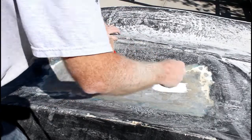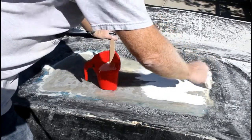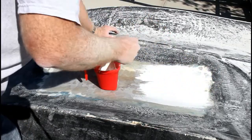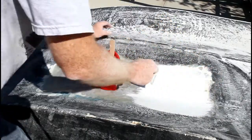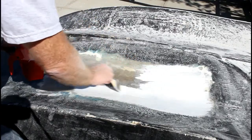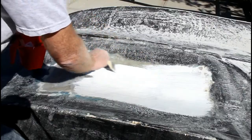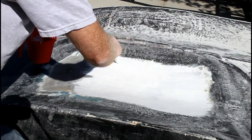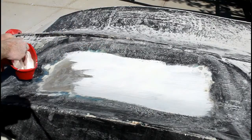This is just a paint-on gel coat — you can get this at any marine store. This gives a real hard, waterproof finish to the repair. Most fiberglass repairs that you do really require a gel coat when you're done. And that's basically it — a very easy do-it-yourself fiberglass repair for through-hull holes in your boat, or really any fiberglass application.